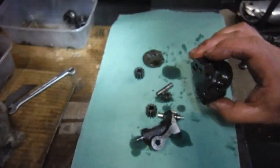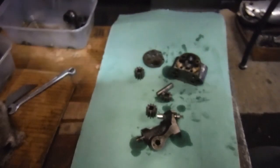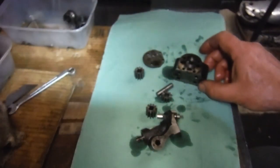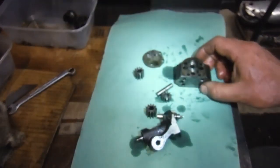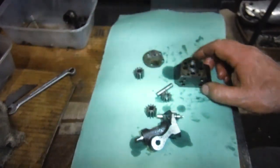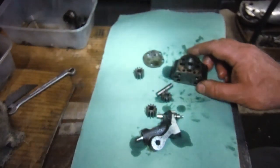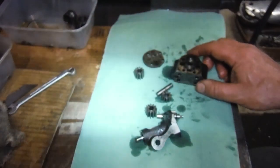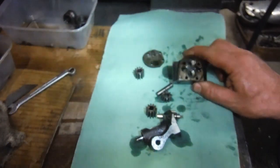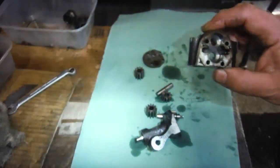It's time to speak to the owner and see if he'd like me to try and get a new oil pump to put in there, because obviously we've got a good crank on minus 20, we've got new conrods — special conrods — we've got new big end shells, the bores, pistons, and rings are all in good shape, and the valves and guides were as well.